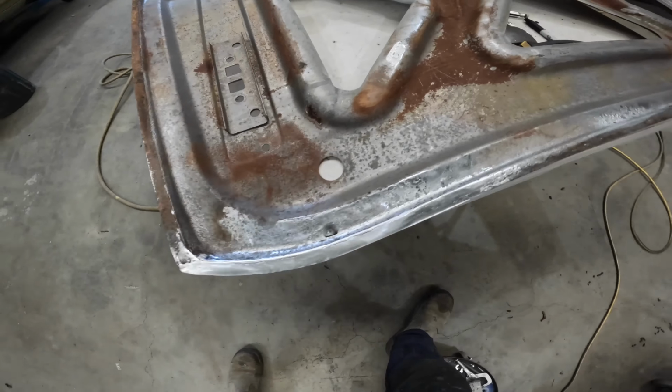So, I guess, I don't know. Do I fit it to the car? Alright, so that's just a rough fit up, and the gap up there is looking okay. This one here is a little tight obviously. I think that where it opens up a little bit, that's my quarter panel, that's not the boot lid. The boot lid there, I'm going to have to add a little bit just on the bottom there. It's a little bit open, but that's nothing.